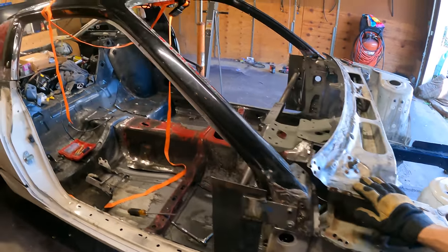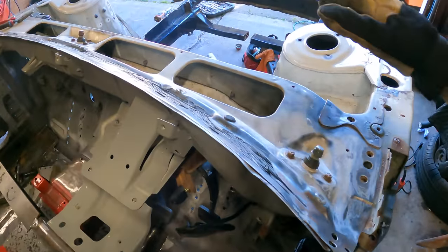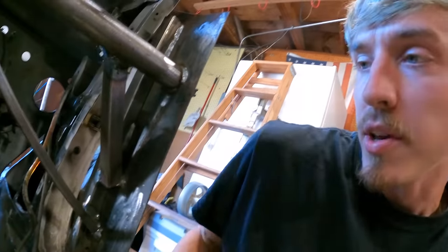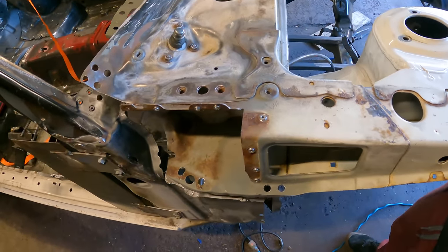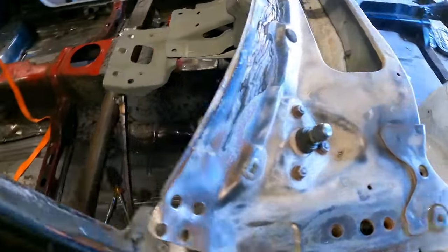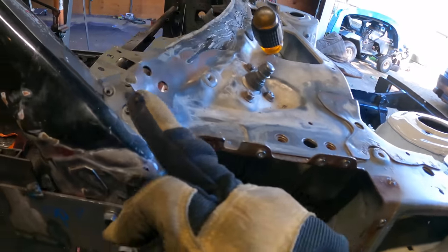The roof has been bolted on. I put a little more tension on the hoist because I needed to raise up the back to align the bolts. Now I need to pull out the firewall enough to slide it under the floorboard, because the correct layering is: trans tunnel, then floorboard, then firewall on the bottom. We're getting somewhere, making some good progress. We have the floor on top — I can hammer that down later — but now we need to focus on this gap and these two curved angles.